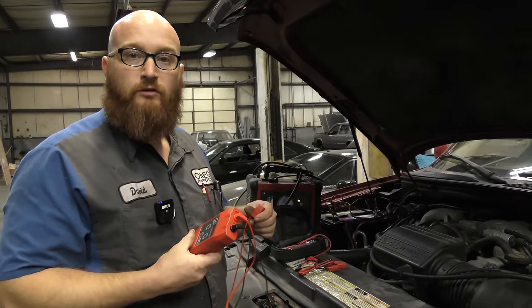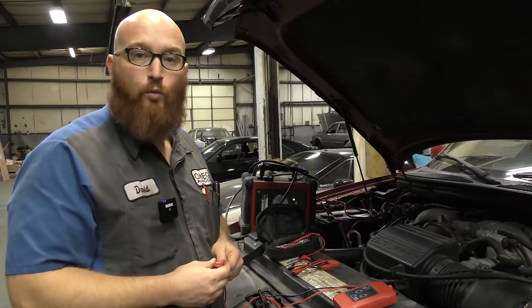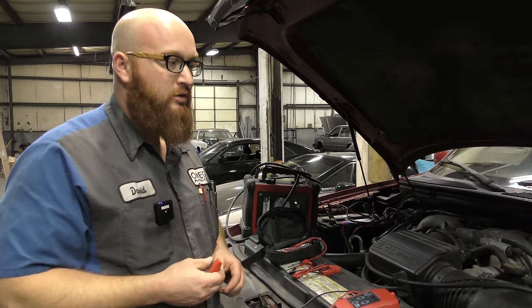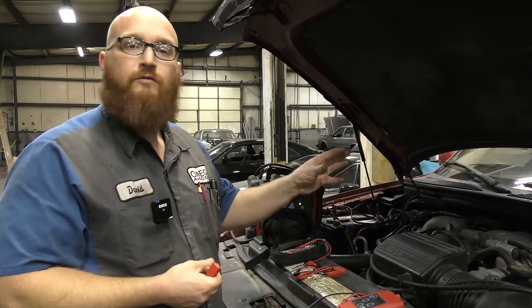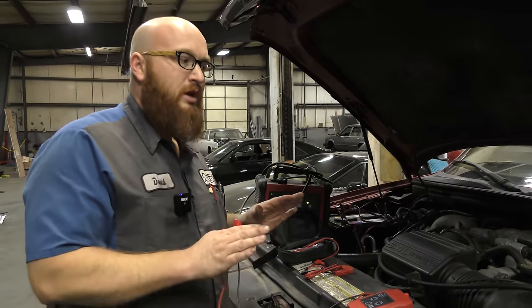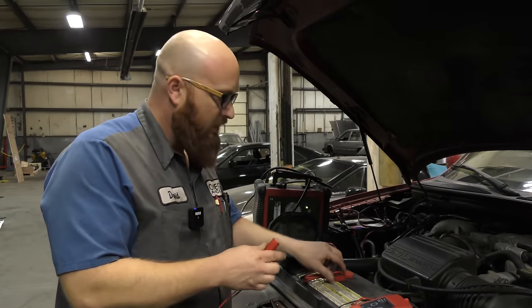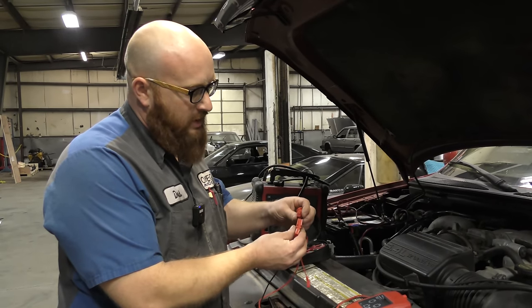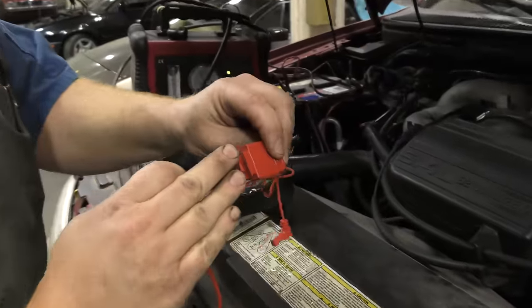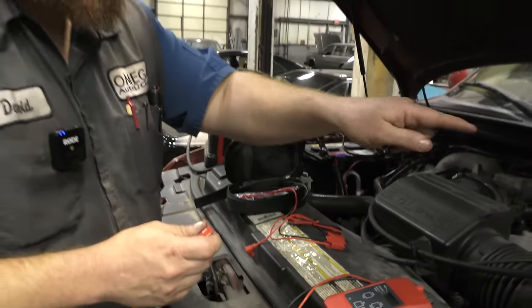What you use is your fuse box. All the circuits in your car are going to run through a fuse somewhere. When you turn your car off, most of the fuses should be dead — especially after you let it sit for a couple of hours so that all the modules in your car go to sleep. There really shouldn't be anything going on more than a quarter of an amp or a tenth of an amp on most fuses. As you can see, this kit comes with various different sizes: maxi-fuse, standard fuse, mini-fuse. It just fits right over the fuse.